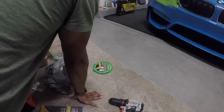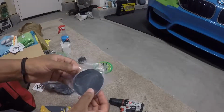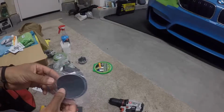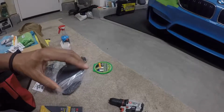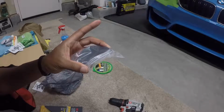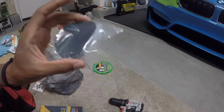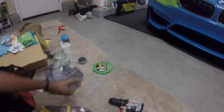And the next one, I also have the Turtle Wax kit that comes with all the discs. I know the Turtle Wax headlight restoration kit doesn't have all of it. It does more of a mild restoration. Usually, if you just have the sun-baked appearance, this will be fine. So I may start with just the sanding block in hand, with the 600, then work my way towards this one.